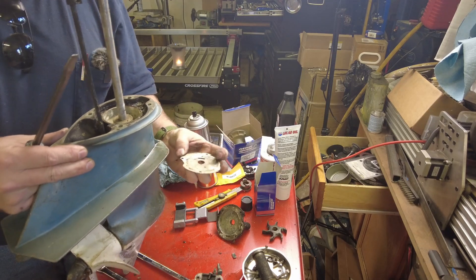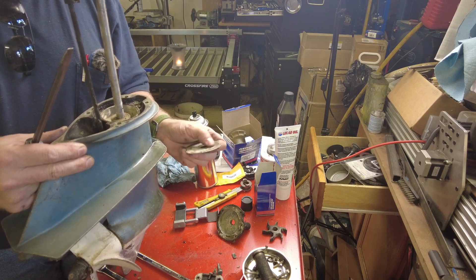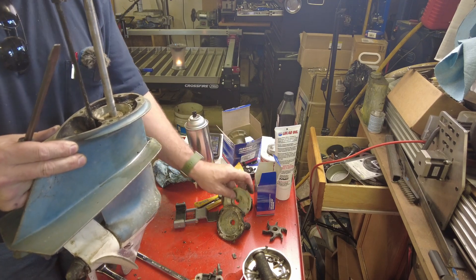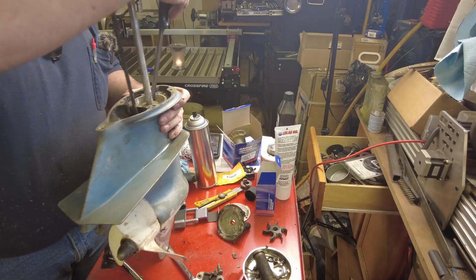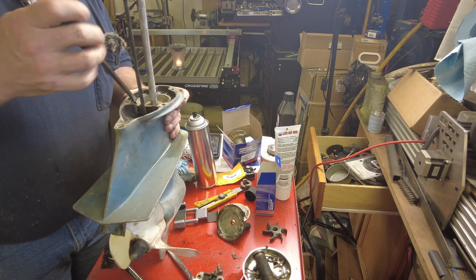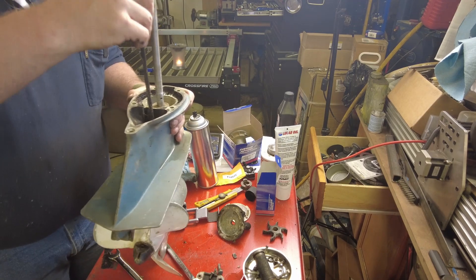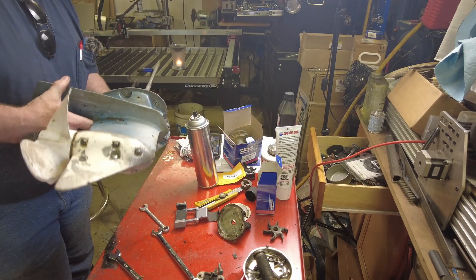There's our wear plate — it looks like it has wear, but when you clean the dirt off of there it actually doesn't look all that badly worn. There's some white stuff down in there; I wouldn't quite call it corrosion since this is a fresh water motor that's never seen salt water. Something definitely doesn't sound very good there, but that is the next thing we want to go after.